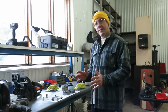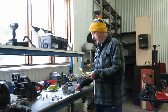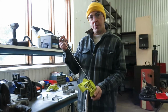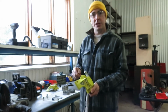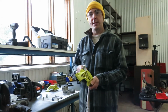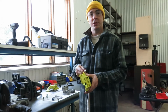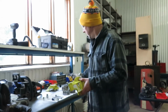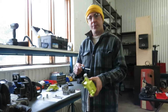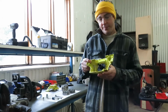For starters, one of the first things I wanted to show was when I tried to start the saw and I pulled on the recoil. When the recoil was attached to the chainsaw, this happened. The recoil wasn't engaging with the flywheel, and I couldn't start the engine. So using my T25 wrench, I unscrewed the 4 screws that hold the recoil on, and I found the following.